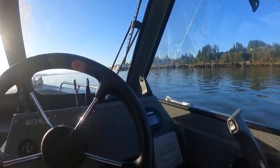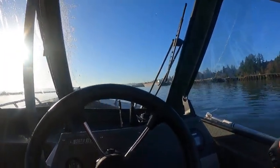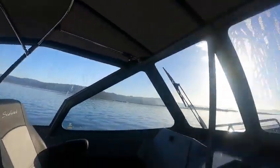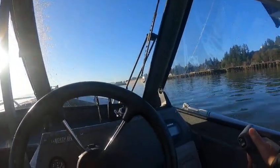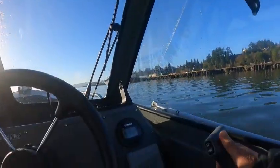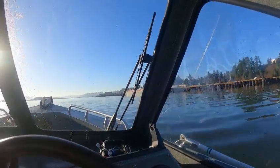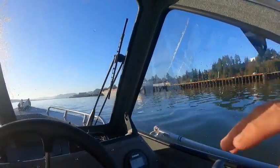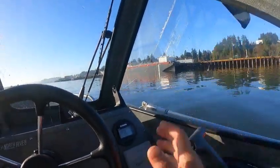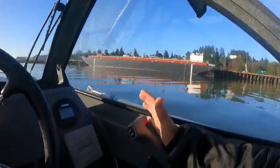See right there, about 1100 RPM it kind of went away, and then sometimes they come back at 3000. This is all normal. There's 2000 - I can start feeling it a little bit again. There it went away. See at 2800, see how that wiper vibrates - that's typical. Yeah, 3000, and then once you get about 3500 it's on top, runs good. That little vibration, if you ever feel that, it's normal because of the stainless.